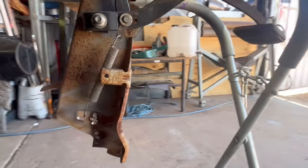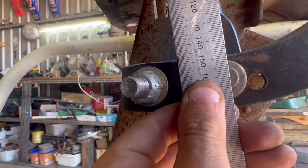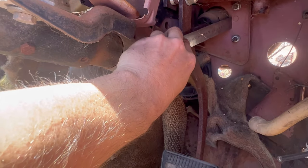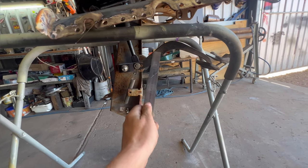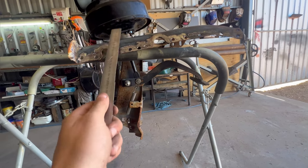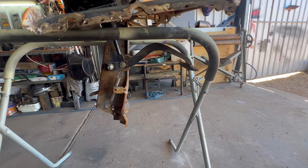A few things to take into consideration if you plan on doing this: I had to go out to a rack and measure from the firewall to the pedal — 160mm on the nose. On the rack that still has the HZ booster and pedal in it, it's exactly the same — right there at 160mm on the nose. I also measured from here up to the edge of the firewall lip, so pedal position is exactly the same as with an HQ booster. When sitting in the car and applying the brakes, the position will be right — nothing is compromised.